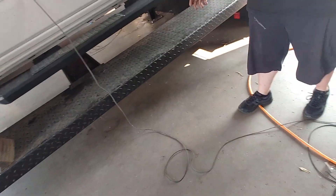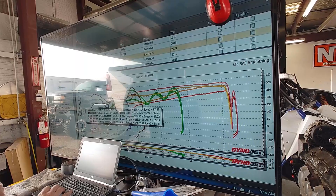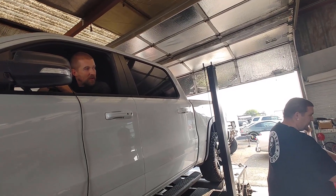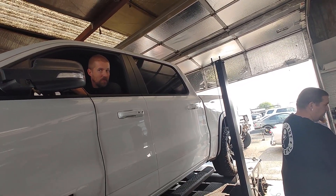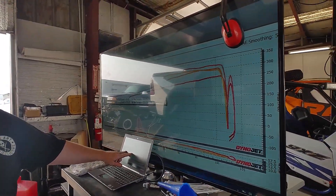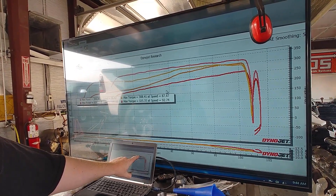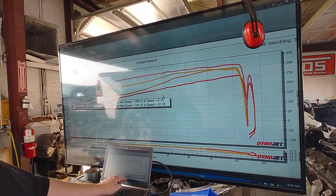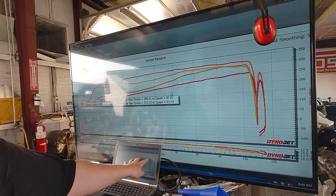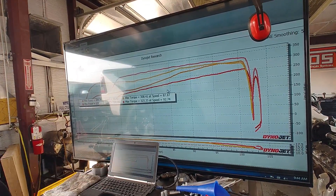It's really hard to get it to stay in gear. I was hoping the manual button would let it hold it, and if not, usually the laptop will let me do it — safety first, I guess. That one seemed like the best one. Your horsepower is dead on and the torque is dead on. So your 304 and 325 — that seems about right. The torque is perfect on that one, and the horsepower is perfect on this one from 85 miles an hour and above. Your peaks are accurate. So theoretically we can match them up — it'd be 304 horsepower and 325 torque.